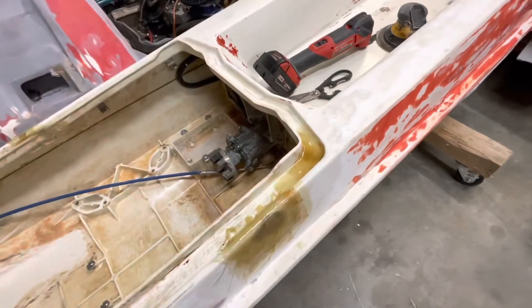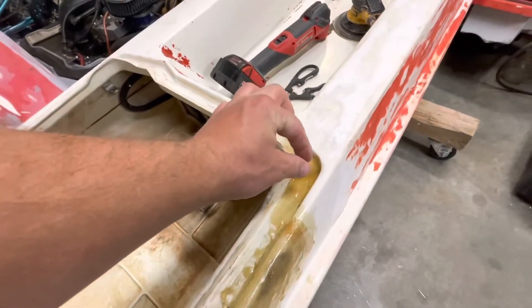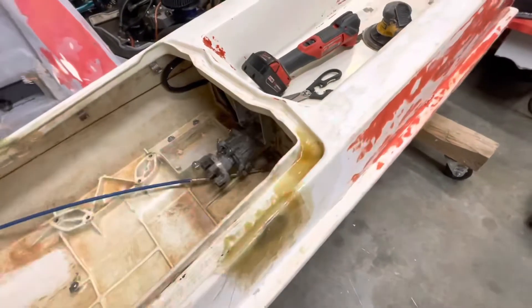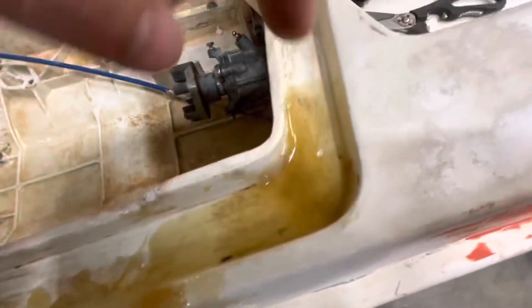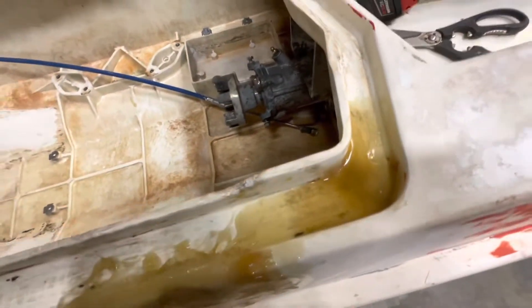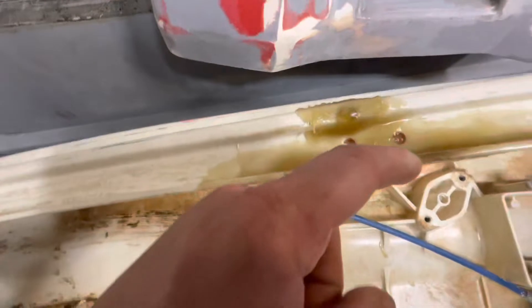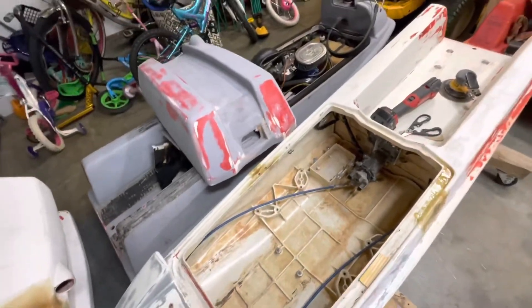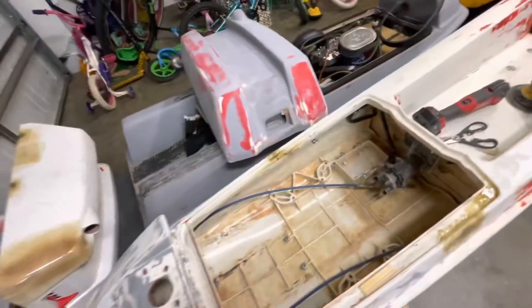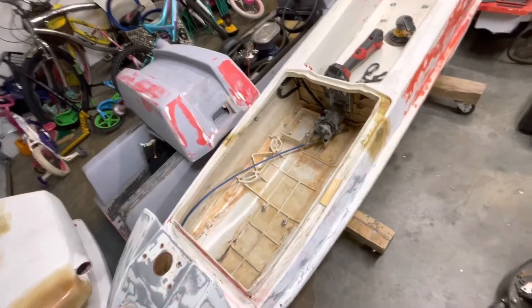There was a crack right here — I grooved it all out. Like any other fiberglass repair, you start off with a small layer then widen it out, basically filling up the whole area with a chamfer or bevel. You can see it's thicker in the middle and darker — that's where most of the fiberglass is. We also had a little rotted spot here that we grooved out and fixed, and a crack here that's fixed. Just got to do some fine-tuning sanding with deburring tools.